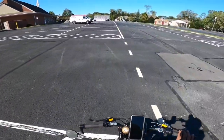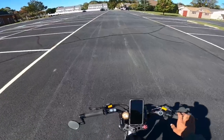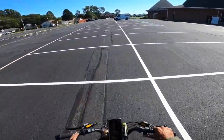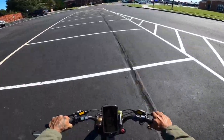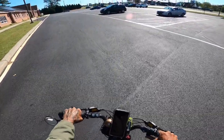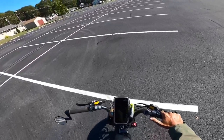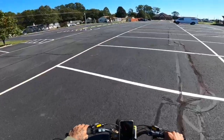I did the front 15 times too. Now I'm going to let the brakes cool down for about 15 minutes, not even going to touch them, and then we'll get to the next step — cruising about 20 miles an hour and then hitting the brakes a little more firmly. Again, don't come to a complete stop. It's been about 15 minutes. Starting with the rear brake: get up to 20 miles an hour, hold it a little more firmly this time, and slow down to about 2 miles an hour — not a complete stop. Going on the 20th time. Now I'm going to repeat the same thing with the front — go up to 20 miles an hour, hold the brake a little harder than the first 15 times.